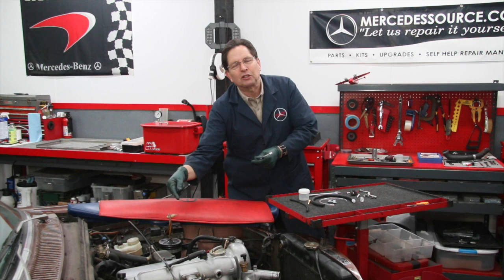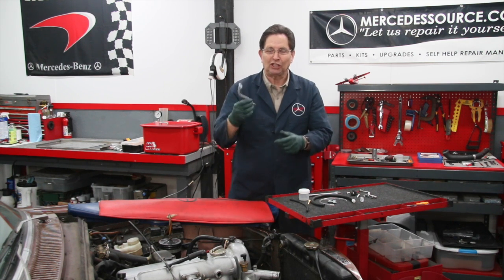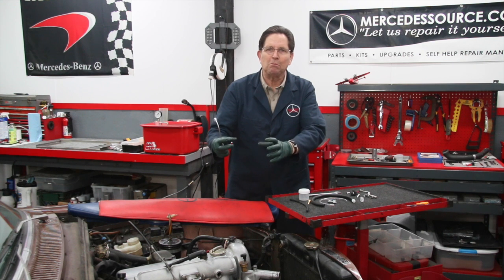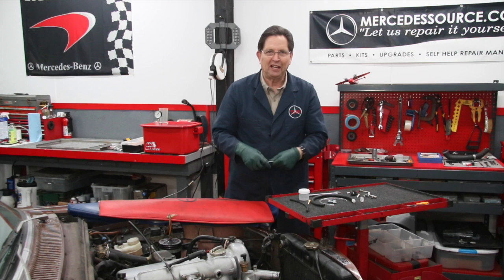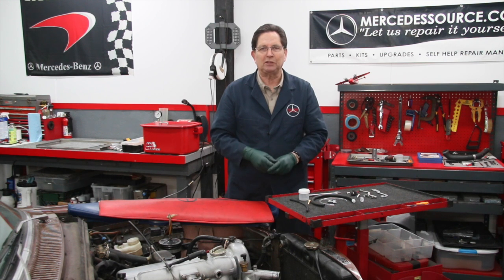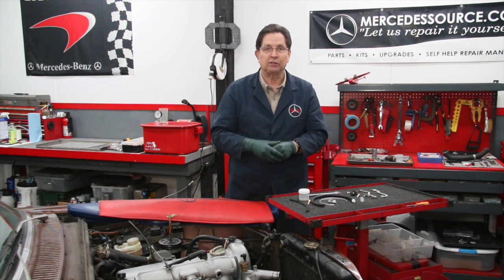Snake its way to the rear bolt for that back brace and get to it to loosen it, so you can rotate the pump — and that's what you have to do when you set the injection pump timing. You have to be able to loosen the pump and move it like you would a distributor. We've actually gone into production today, right now in the shop. We've set up the jigs and we've started heating these wrenches. We had to get a very long special high-quality 13 millimeter combination wrench to start with.